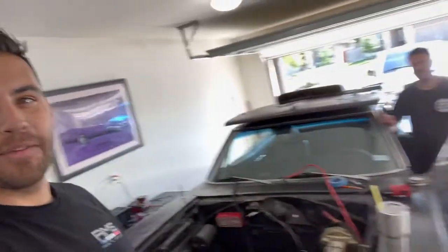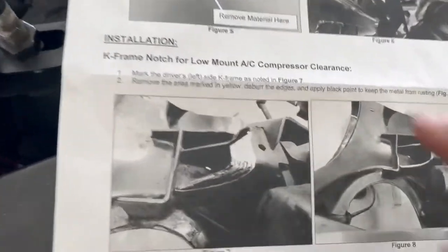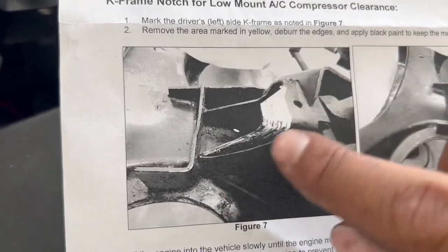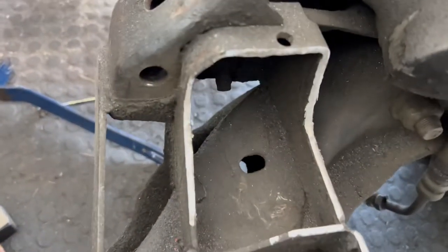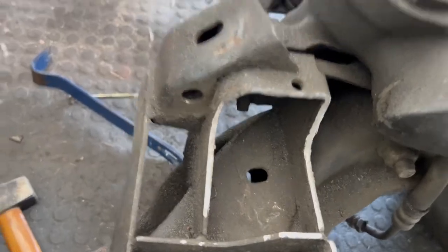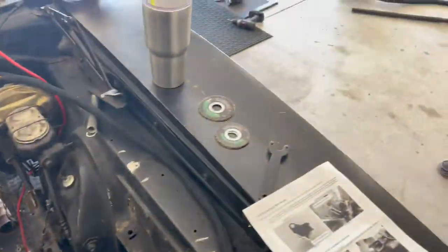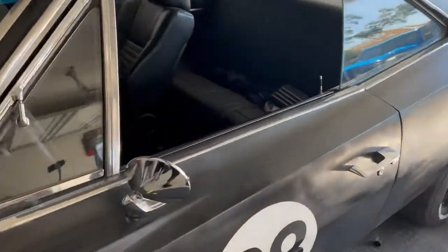Update: I've been cutting and grinding for over an hour. He's been ripping out the interior. Let me show you what I cut — here's a quick diagram, it's upside down. It basically marked out this section with sharpie, cut it, and it ends up like this for the AC compressor to clear. Here it is all cut out. I need to get a file and clean up the burrs off the edges, but overall I cut a little more than needed — the last thing I want is to put the big Hemi in and have it not clear, so I think I cut more than enough.